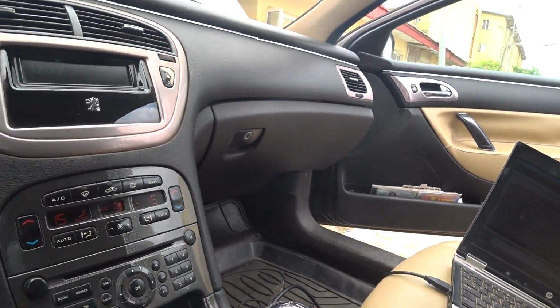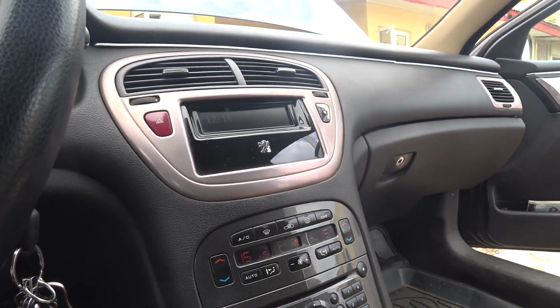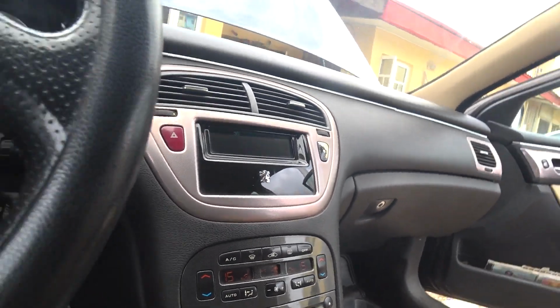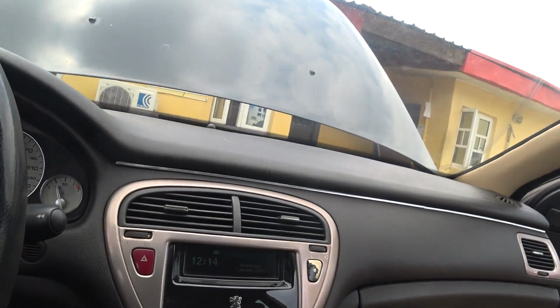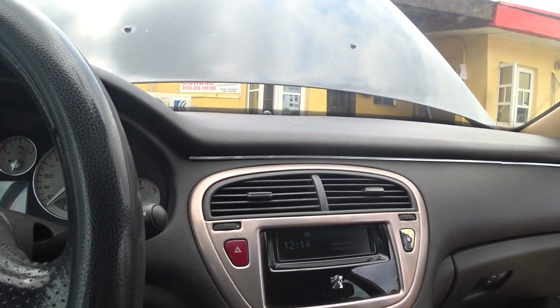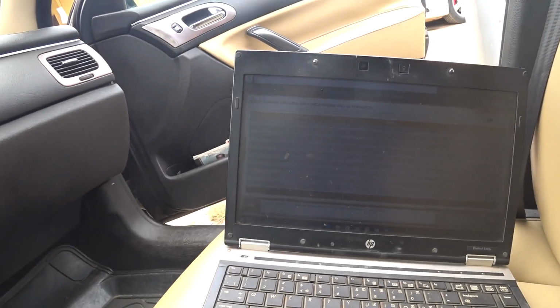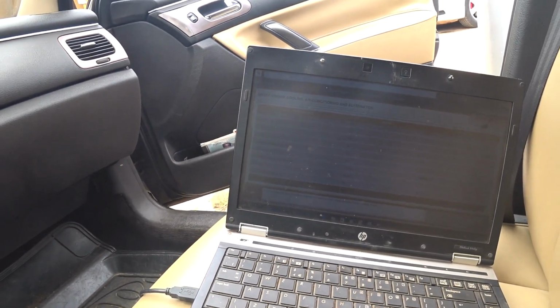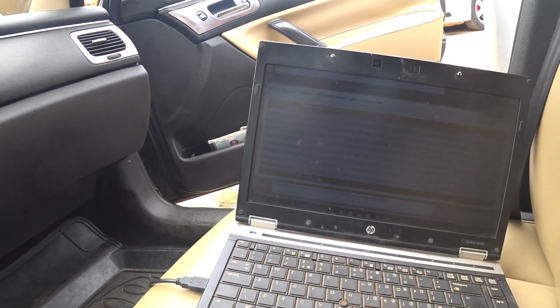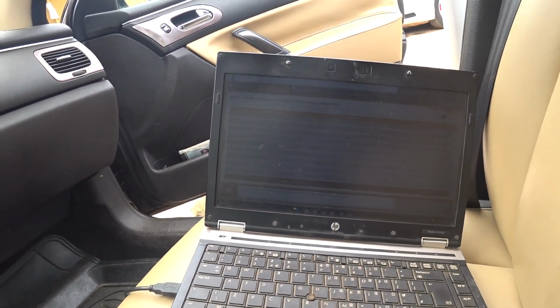I think that with the other fan, if I switched on the AC, even from here I'd be hearing the sound of the fan. But this one, I don't actually hear the fan speed, maybe just a little, unlike the other one, which would be shouting. So I think this is much better. What I should have done with the old fan, before I removed it, was to check at what speed it was spinning at 28 degrees Celsius, the percentage cooling fan speed. So 56%